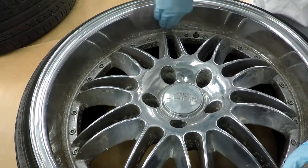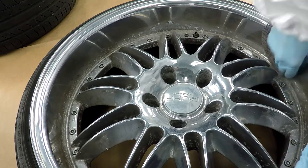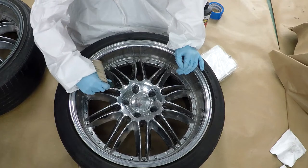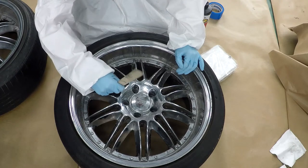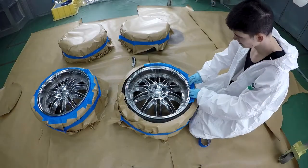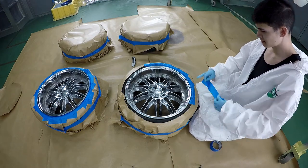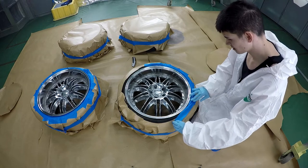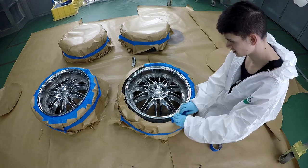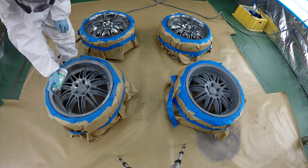Start off with some 80 grit, just trying to smooth out the surface — I don't want as many flakes in my paint as possible. This took forever, probably took me a few hours. After I was done smoothing and was happy with it, I just cleaned it with some scotch brite doused in wax and tar remover. Chrome is metal obviously, so I used metal etch.